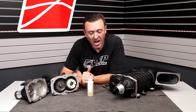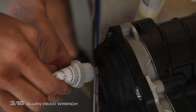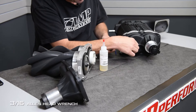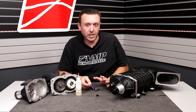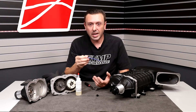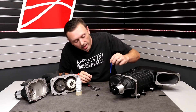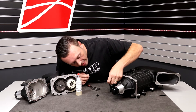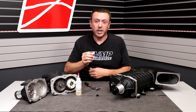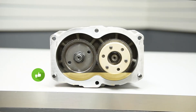The oil level inside the supercharger is incredibly important because you can overfill the supercharger if you really try. I actually went out to the shop and kept pouring oil in until it spilled out — that's all bad, never do that. One of the common questions we get: people open the fill plug, look around in there, and don't see any oil. The supercharger only needs about 3.4 ounces of oil, and this whole cavity is pretty darn big. If you're ever curious or concerned about the oil level, we recommend you take a dipstick — I made one here out of a zip tie, wrapped it with some blue tape for better contrast — and stick it in here. Once you get it far enough down past the gear, you will find some oil. You're not going to find a whole lot just because the 3.4 ounces only sits about this low on the supercharger.